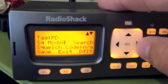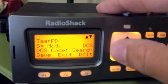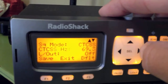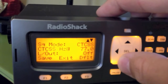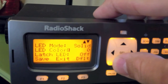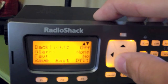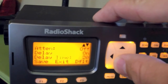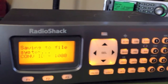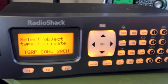You can adjust the squelch mode — CTCSS or DCS — and select the squelch codes if you have them. You can make it a priority channel, set your LED colors and modes, alarms, and backlighting, all individually set by channel. And that's basically how you program by hand. It's pretty simple once you get the hang of it. Hope that helps.